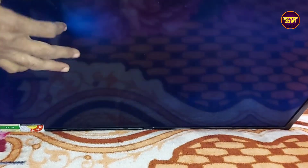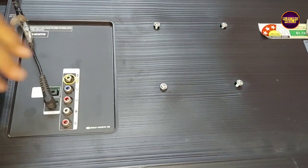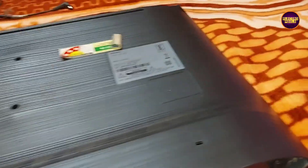As we discussed earlier, these types of complaints are mainly due to internal shorting in gate signals inside the glass panel. The shorting may be either from the left side or right side of the glass panel. If both sides' gate signals are shorted, then it's difficult to repair.